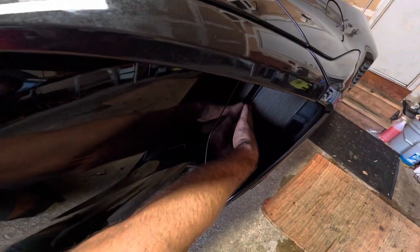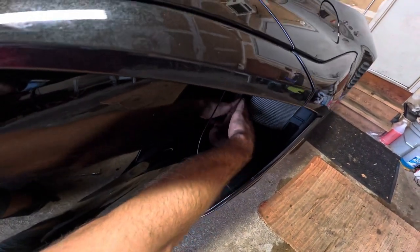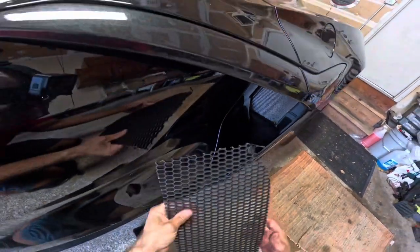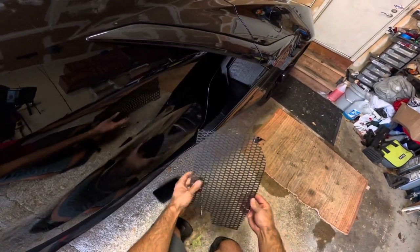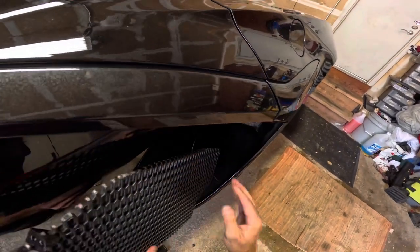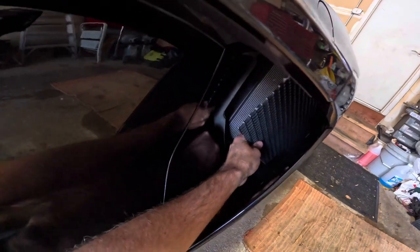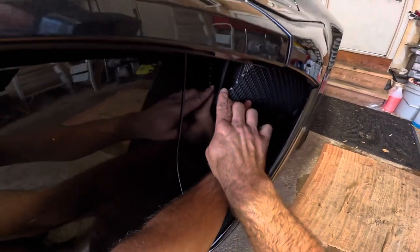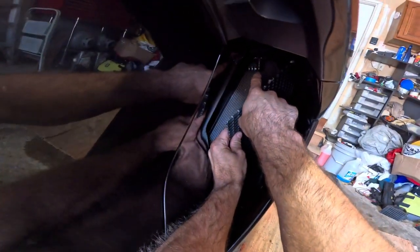As always, you can protect your paint. We're going to be quite careful when we go in here, but you can always protect your paint with some blue painter's tape. We're going to send in the grill — this one is going to be our driver's side grill. Brackets come pre-installed. We're going to slide it in, get it all the way to the back of the cavity, then rotate it, putting this corner up into this corner while keeping it in front of that valve.